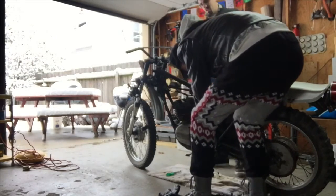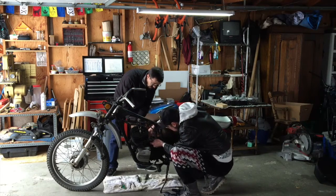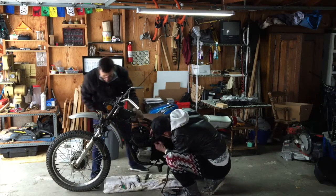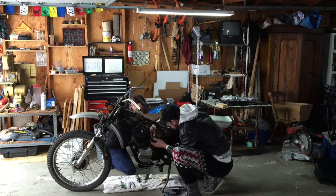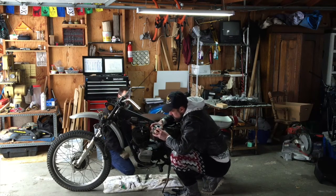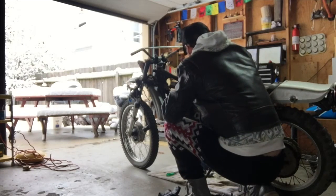So this is the carburetor. The carb should come right off — you've got to tweak it a little, it's caught on a gasket. The rubber's got a little bit cold. Twist it. So we'll take the carb off, maybe take it inside, drain the fluid, and spray some starter spray in there to lube it up. Then put a little bit of Vaseline on the spring so it's freed up when you put your bike back together.